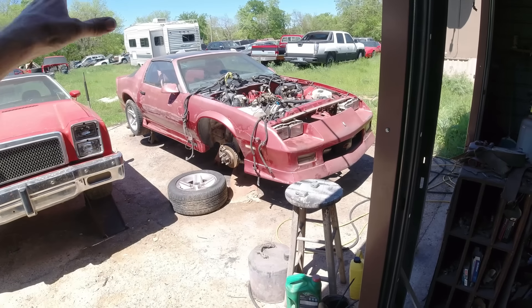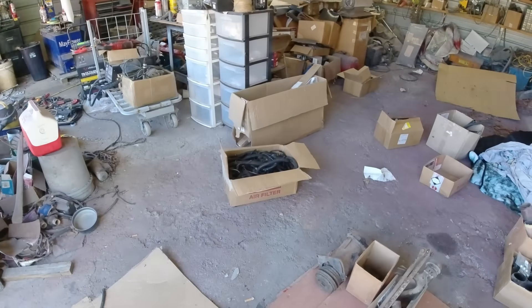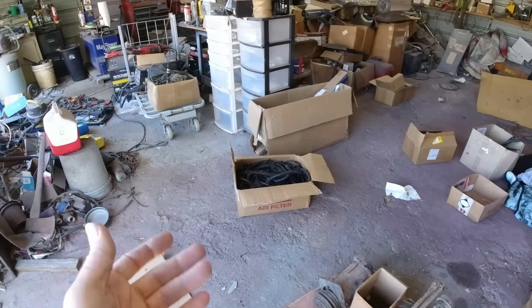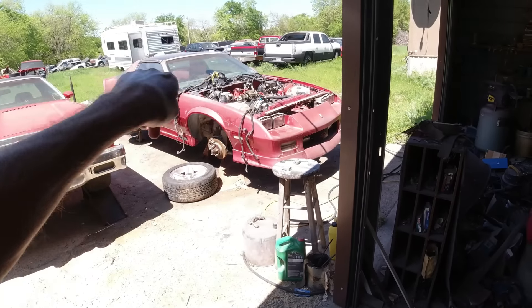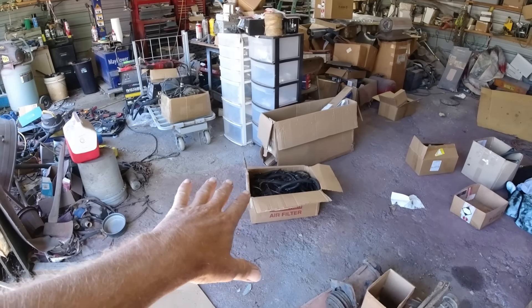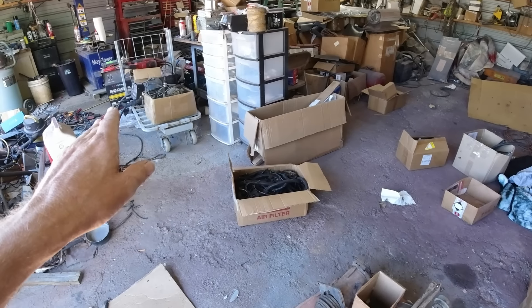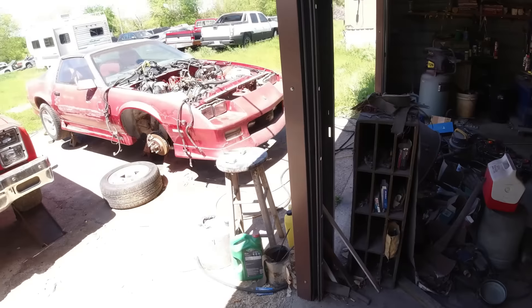Here's the harness in the box — I haven't even taken it out yet. This is what I got, and it came with the ECM. He said it's in perfect shape, it was in his closet for 20 years and he just never used it. I'm going to spread this out and see what we got. This is not going to come with the injector harnesses since it was a carburetor. It'll have the electrical connections to the carburetor, but is that compatible beyond the firewall where it plugs in — is all that wire going to be the same? That's what we need to figure out.